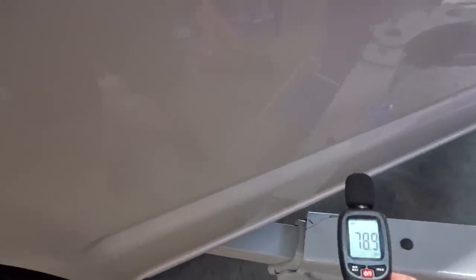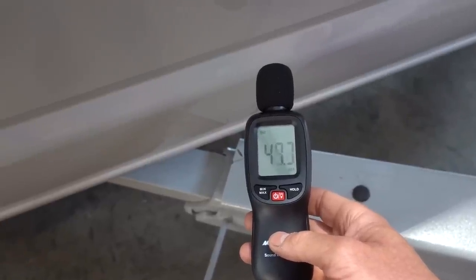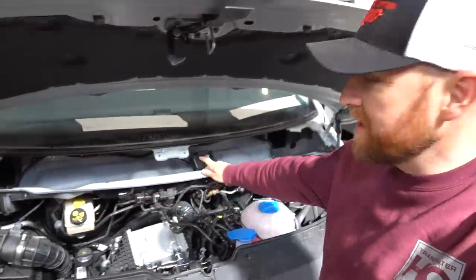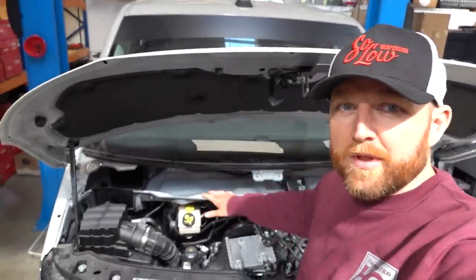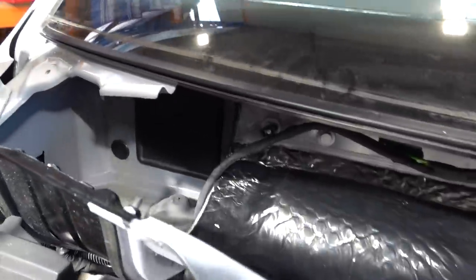It's definitely made a difference — it sounds quite a lot quieter outside and the decibel meter shows a small difference. It's definitely made an improvement; ideally if we'd been able to fit the Sound Stopper before fitting the compressors, I think it would have made a massive difference. We've decided to go all out on the 6.1 and also soundproof under the scuttle tray and right up under the dash, because it does make a really big difference. You do have to take the wiping mechanism out, but it makes a big improvement on noise coming from the engine — and that's all done everywhere we can.